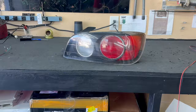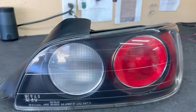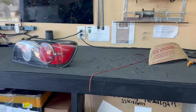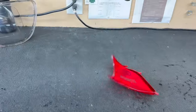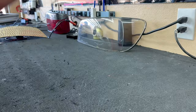The boards are completely built and programmed with everything testing good. Now it's time to get the lights out of the box. These taillights are relatively basic but have a nice clear lens which gives a lot of possibilities — especially for color shifting or infinity mirrors. I'm going to film a separate how-to-open S2000 taillight video. Once the lens is off, we remove the little reflector pieces by popping them out with a screwdriver, one at a time.